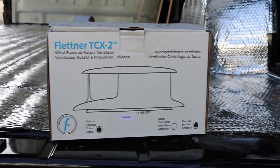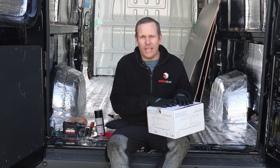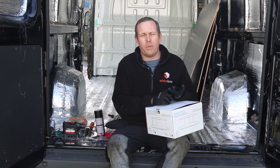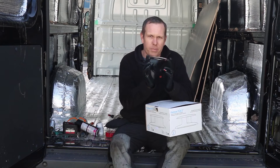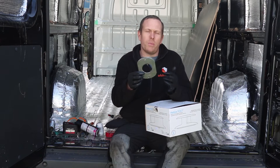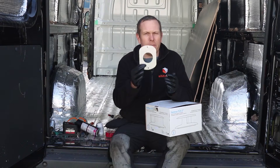Hello, I'm Mark from whiteboxuk.co.uk. Thanks for joining us on our install video for the Flettner TCX2 roof vent with narrow base. We're going to be fitting this to a Peugeot Boxer. We found a little bit of a problem with fitting these — even though it's got the narrow base, which is supposed to go between the ribs, we found it actually won't fit between the ribs of the van. You're also going to find this problem on some Fiats and some Citroens. As a workaround, we've had to make up a plate, which I'll show you in a bit. It'll go on the bottom of this roof vent and slightly overlaps the ribs on top of the van, so you can seal around here with this smaller hole. If you want a template for this, or even one made, please contact us by messaging at the bottom of the video.